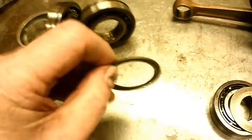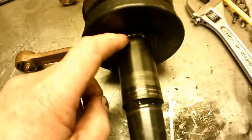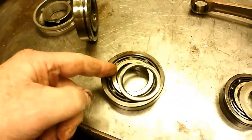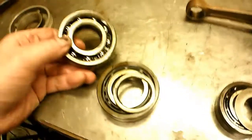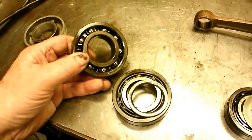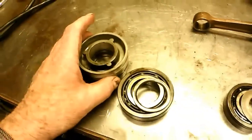Now, next to the web on the crankshaft, you've got this spacer on there. This makes sense to me — it spaces the crankshaft out, gets it away from the radius. Anytime you grind a shaft, you're going to have a radius in there, and it spaces it away and allows oil to get into the bearing. But once it gets in there, how's it going to get through that thing? I don't see much way they have of getting oil to the outer bearing on the very ends. It seems to me they're really trying to stop oil from getting in there.